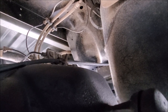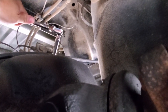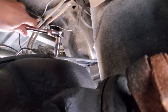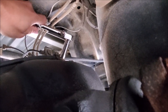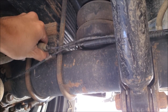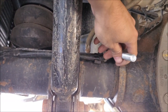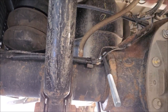The first thing we're going to do is loosen up all these brake line brackets, because we're installing something the engineers never designed to be here. We have a few things in the way, so we're going to loosen these parts and then relocate them with the provided brackets. We've taken the bolt out of the spring perch and we want to get the lines loose — that allows us to put in our u-bolts and then loosely put in our sway bar to test fitment.